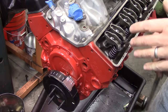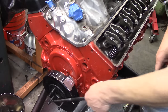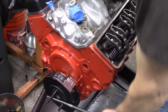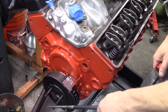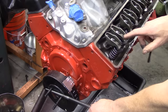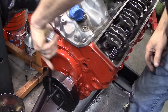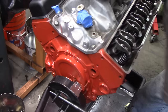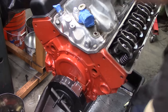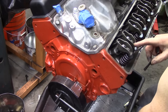This is number one. The way you can do that is you rotate the engine and watch your intake valve here. We've got some studs in here that are going to allow us to rotate this engine. We're going to rotate this around until our number one intake valve here opens. There's the exhaust closing, and there's our intake — our intake valve is opening right there.